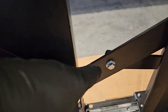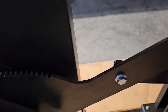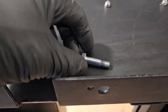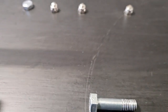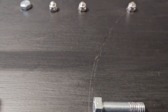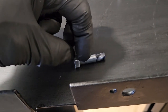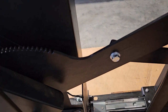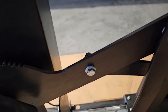The bolts going through the bushings were fully threaded bolts, and with no bearing surface on a fully threaded bolt, the thread wears through the bushings. What I did was get some longer bolts with a longer shank than I needed, put a die on them to add more thread, then cut the end to the size I wanted — so now I've got a shank on the bearing surface inside. I had to do this for four bolts, as the thread had worn through the phosphor bronze bushings.